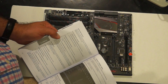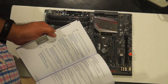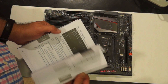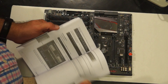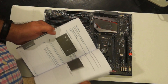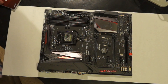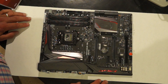The BIOS on this thing is far more advanced than what I'm used to. Hopefully I can get some screenshots of it while I'm working through the BIOS. It has CPU configuration, platform system agent, USB configuration, and all sorts of tweakable settings. I'm going to go through a BIOS update shortly after first boot — most likely the CD that came with it includes a BIOS updater you can run directly from Windows, so you don't have to go through the whole USB stick flash process.